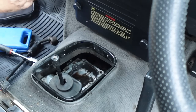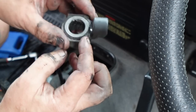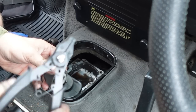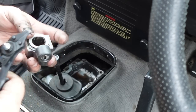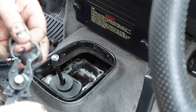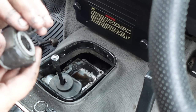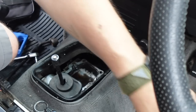It's absolutely minging — let's give that a clean. So this is our knuckle, and you can just see there's a circlip there which we're going to remove. I've got these circlip pliers from Screwfix, they take four or five different attachments and they're only six quid — so even if they just work for this application, that's pretty good value. Let's put them in there, open them up — off it comes. Six quid, they did work. Now this is where we've got our bush, and that just pulls out.